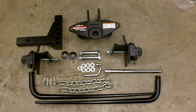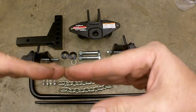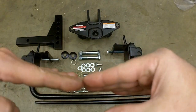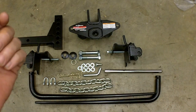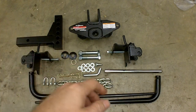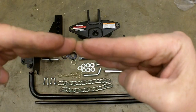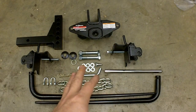What this is for is when you're towing a trailer, there's a lot of weight on the tongue. It will push down on your tow vehicle and, in effect, raise the suspension in the front. And it will make for a hard-to-handle situation — you have a little bit of difficulty with steering sometimes, especially in a wind condition, as well as braking, because you don't have as much weight on the front wheels. What this does with these bars and chains is it effectively lifts the rear of the vehicle so you can get everything in the same plane, and it makes everything handle a lot better.